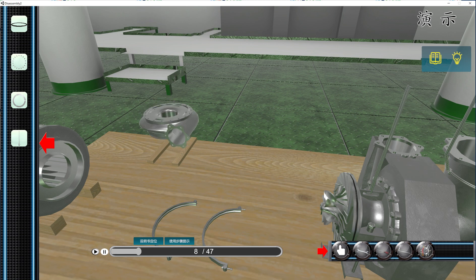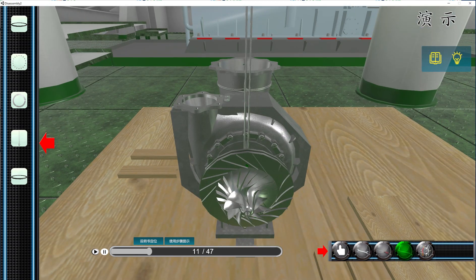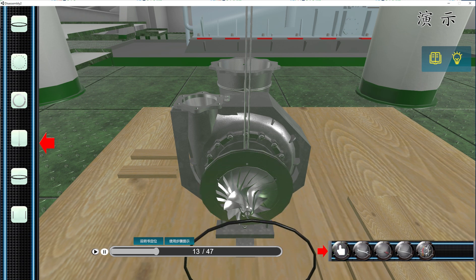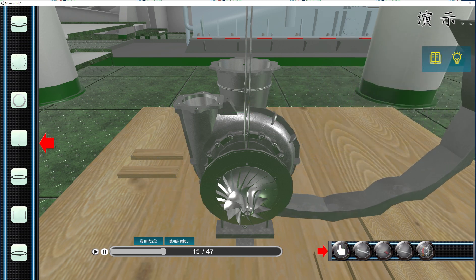The o-ring will be replaced — in most cases these o-rings are really destroyed. We can remove also these parts, but they are not going so easily — everything will be stuck from the dirt and from the temperature. So also this part will be removed here. This is another part of the turbocharger, so the o-rings will be really damaged. Now we remove also the cover — I really like removing turbochargers.